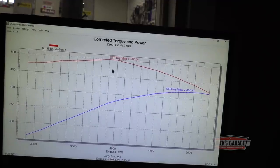There it is. Hey, after all, it's a basic stock 440. And right from the factory, they advertise the 390 horsepower. In reality, it's not 390. I'm telling you right now. We cleaned out the bowl area. We zero decked the block. We put a little cam in it, more lift, a little bit more duration than the factory did. And we're getting just 421, 422 HP, 500 torque.